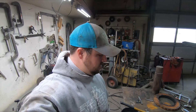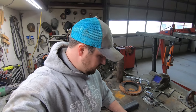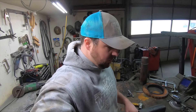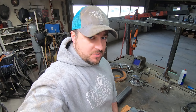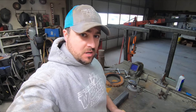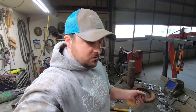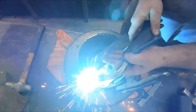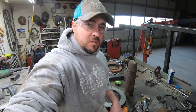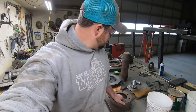After drilling the two holes, we'll see if this lines up — I've got two bolts from the engine crankshaft. Perfect. Hopefully this works, I don't see a reason why it won't. I'm going to flip it around and use the harmonic balancer as a template, put it on top, and just tack weld the edges of the plate so it stays centered. How smooth is that? I'd say it's about as smooth as a hippo baby's butt. That is smooth — that's what I need.